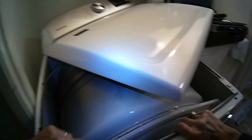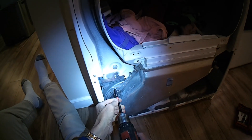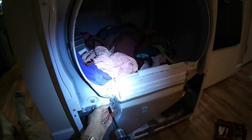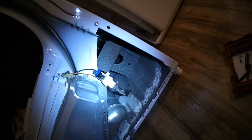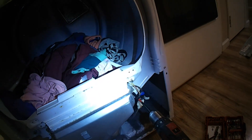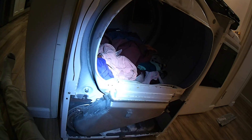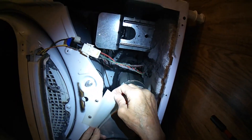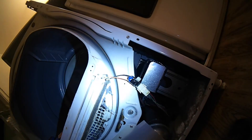With the door closed, just wiggle and lift — the front panel should come right off. Set it to the side. Now we're removing the quarter-inch screws holding the filter housing, then remove the filter and pull the whole thing out. We'll also pull off a small plastic plate held by a couple of screws, and that gives us access to test the thermal fuse.